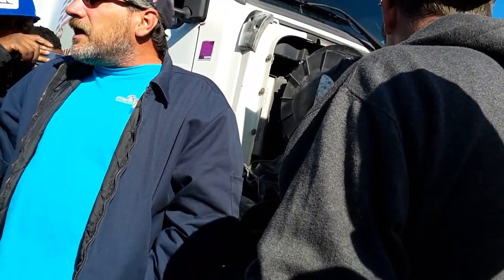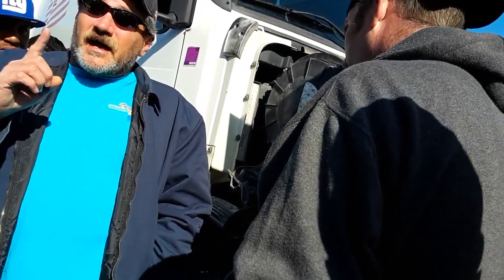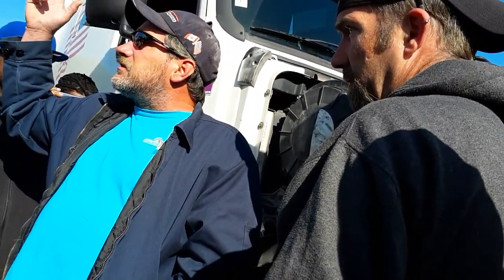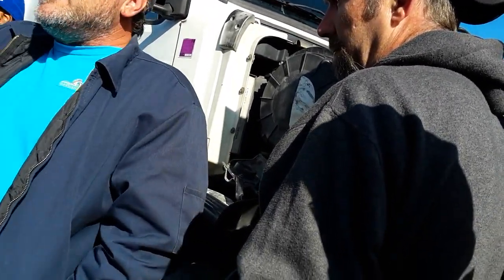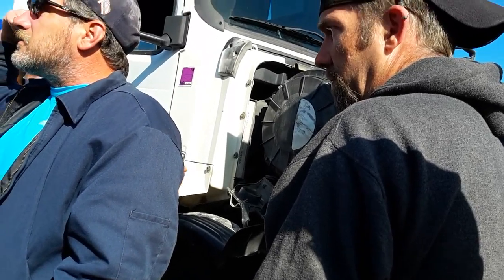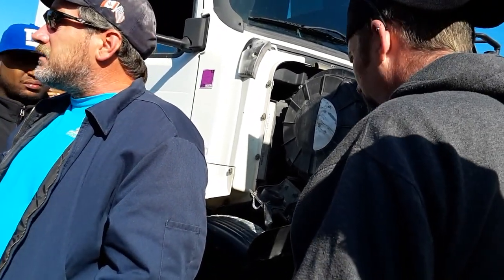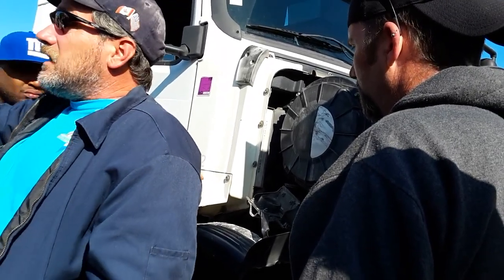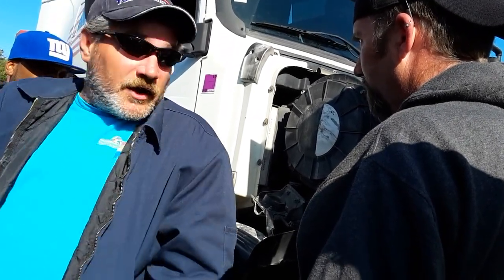A, you can't check it. Everything's internal. B, there's one thing you would look for. It's a sign of a leak. I know you know it. What is the sign of a leak on an exhaust system, ma'am? Black soot. Very good. Did everybody catch that? I need to hear that when you're taking your test. Black soot, that's a sign of a leak. The exhaust system is supposed to be completely sealed until the exhaust exits the tailpipe. So if you see any signs of black soot, I need to hear about that, okay? All right, driver, continue, sir.